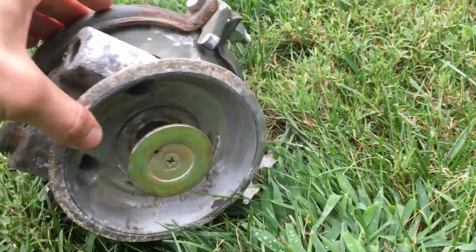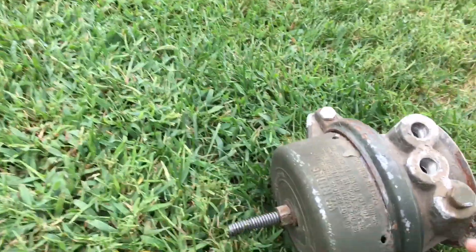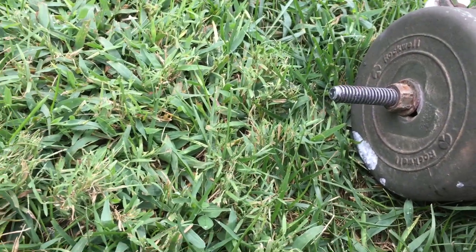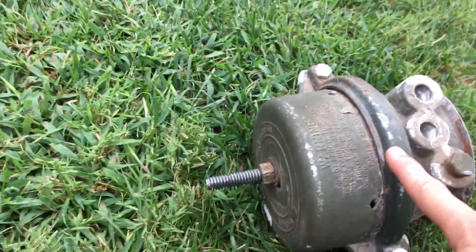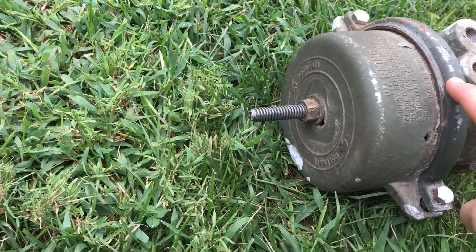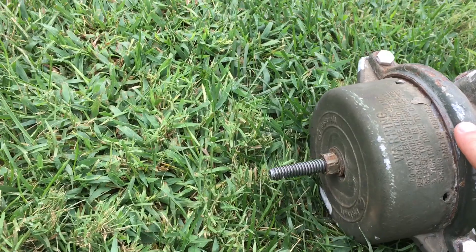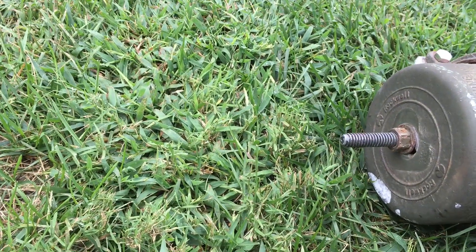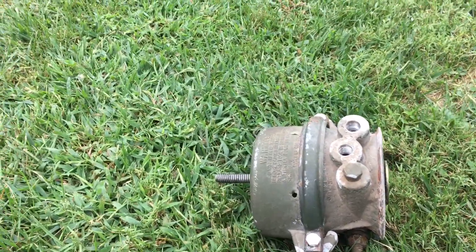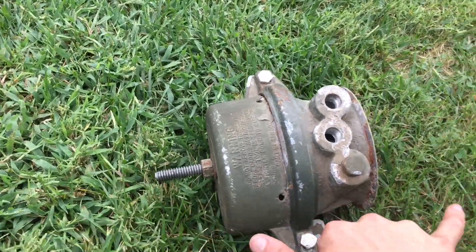The caging bolt's still in this one because we used a caging bolt from another chamber — just took one out, cleaned it up, and used that one. When we were planning to just do the diaphragm, we used that one, but after we found out they were corroded we just stopped. Right now, all three other chambers need to be replaced — they're all leaking as well, though they're very minor. This one was the worst and started leaking really bad. The other three need replacing too but they're minor leaks and the truck can still be used and driven.